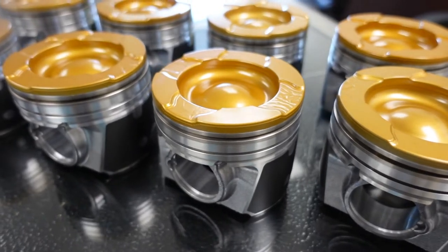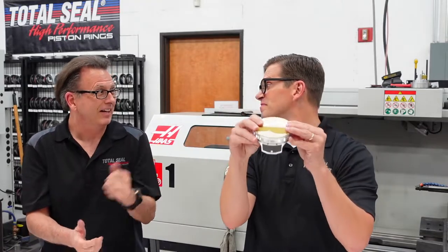Just a quick story. Customer doing big diesel pullers, big power. 250 pounds, that's some cylinder pressure there. Oh boy, is it. All of a sudden, he's having ring problems. And we kept digging and digging and digging. What we came to find out is they use the same length pin on one bore size. And then he made the bore size a lot bigger, but kept using that same pin. Guess what? Whole lot of piston with no support in it. More area to move. And it was binding the rings up in the grooves. Got it. Right, so that's structural support.